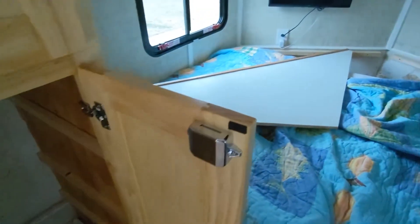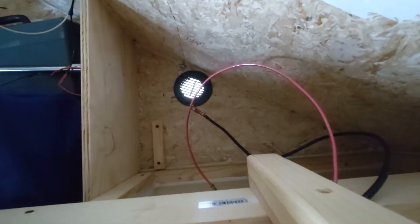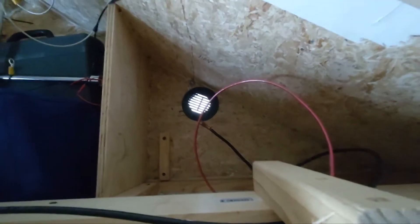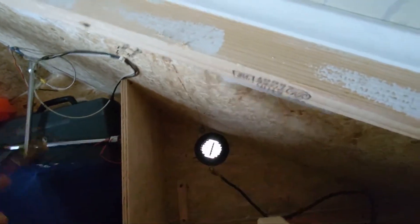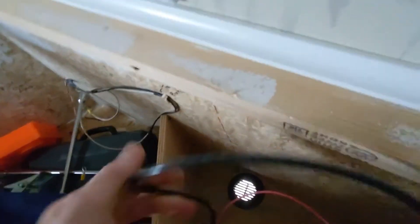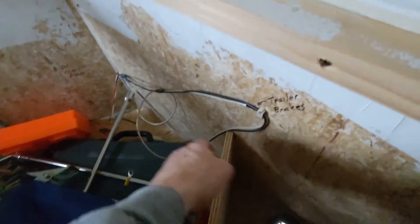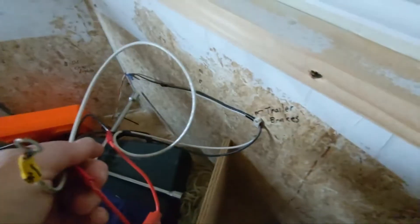From the access panel I've got those wires run up to this access panel up in front of the bed — this is where the battery will be. You can see I've got a vent in the floor there that was for the old lead-acid battery. I don't think lithium batteries need that at all, but it's there and it won't hurt anything. I've got my red wire and my black wire, and also the house wires — the house battery — which go to the trailer brakes. That has a fuse to protect the system from the main trailer chassis, and that all gets hooked into the battery as well once I get the battery back here.